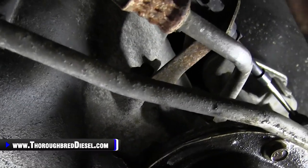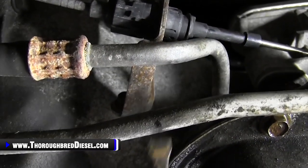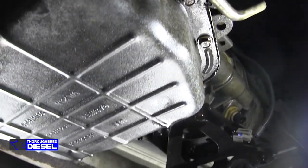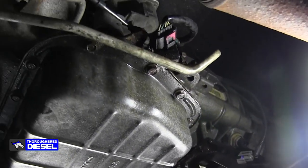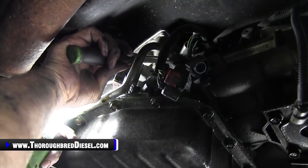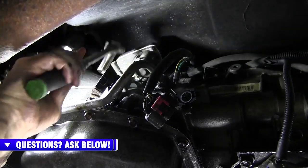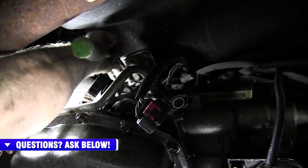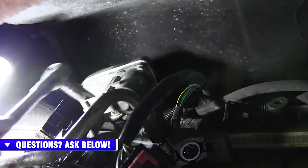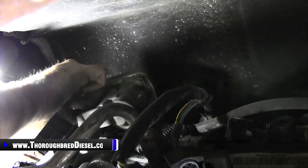There's a 10 metric bolt here and then another nut to unhook that from the bell housing. The electrical connector on the governor pressure solenoid — the connector is actually against the transmission. So if you can't get your hands in there, go ahead and take the two bolts out of the governor pressure solenoid. That's going to allow it to swing around to where you can get to that connector. Pop it straight down, undo the catch on it, bring the catch straight down, and your connector will just pop out.